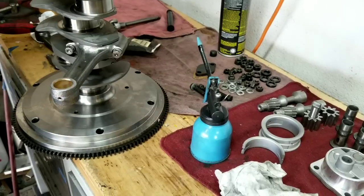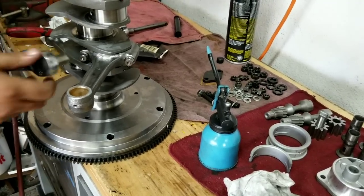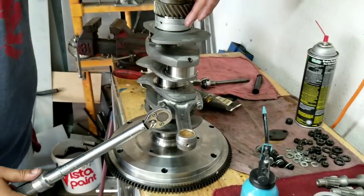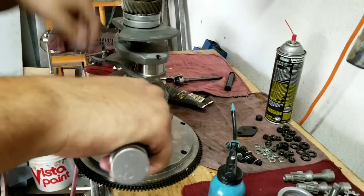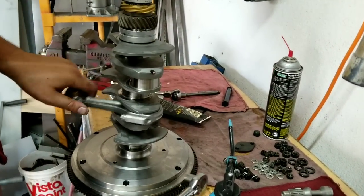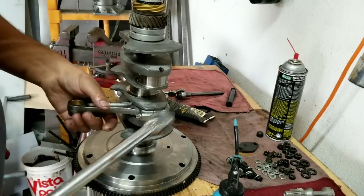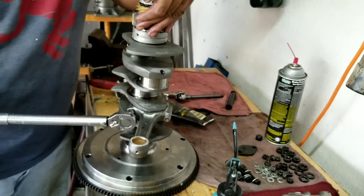We're using motor oil — actually a combination of 20-50, Marvel Mystery Oil, and assembly lube. Everybody has a different formula. Some guys just use straight motor oil; I'm the old school guy who uses oil and STP mixed, but that can be a bit too thick for this kind of motor with very tight tolerances. What you want to do is run your rods around and make sure there's no tight spots — that's the main thing.